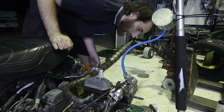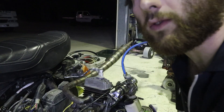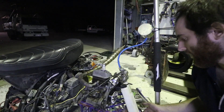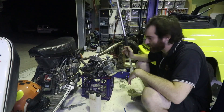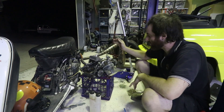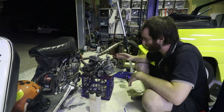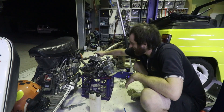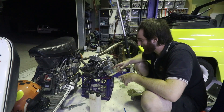It's leaking fuel again, but other than that it sounds good. Can't even see it leaking because the camera's focused on the wrong bit. Looks like it's leaking fuel off that nut thing on the bottom of the carb. So I think that concludes it for tonight's video. Apart from fuel all over the floor, that worked pretty well. Sounds good, sounds revvy. It was bogged a little bit — I think it needs an air filter on it to get the vacuum to pull the fuel through. But it runs. It didn't seem to be doing anything weird, didn't make a knocking noise, wasn't doing anything crazy. It didn't instantly seize up.